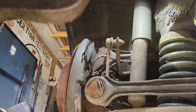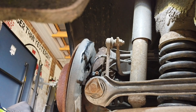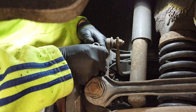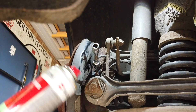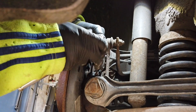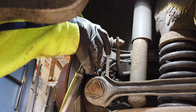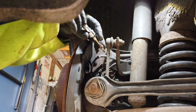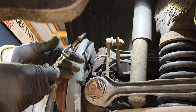It's going to be tight getting the sensor out — it's been in there a while. This car is a 2010, so it's nine years old. Nine times out of ten it's the nearside sensor or ring that gives the problems — it's the one that gets the dirtiest and wettest and corrodes quickest. We've got the ABS sensor down here, and I've given it a squirt of Rost-Off to free it up a bit. If you have a code reader, you can check which side is faulty before you start to save yourself doing both sides. That's a 5mm Allen key bolt.